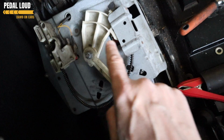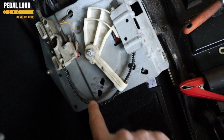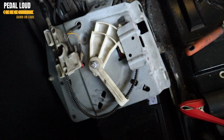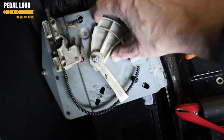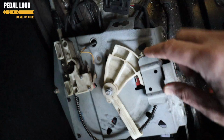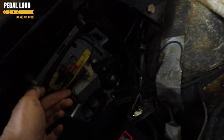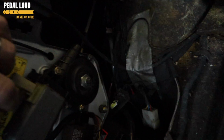It has various positions and various micro switches, 2 here and 1 down here, which click in and out. So what you have to do, basically, if your cogs have been stripped, is loosen off that clutch. You need to position this whole arm, and it has a metal bit there that stops it in this position. So you can do that. If you look around the other side, I think it's a 21mm. It's a bit dark. Let's see if we can get this out of it.